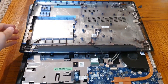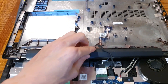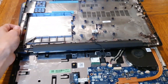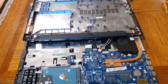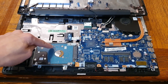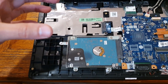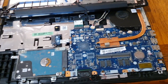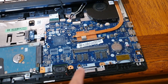This is what the laptop looks like once you remove the bottom housing. You'll notice the battery here with a cable running straight into the motherboard — so when you remove the back plate, have something underneath to prop it up so you don't strain that cable. I'm using a wireless keyboard to prop it. Here we can see everything we need for the upgrades — fan, CPU, all that stuff we're not touching. Right here is the hard drive sitting in a bracket, which we'll unscrew and replace with our solid state drive that has our cloned Windows installation.